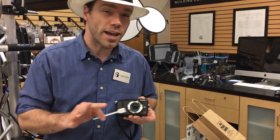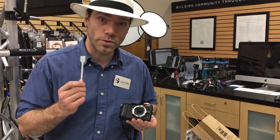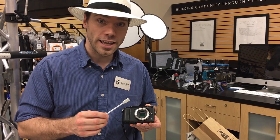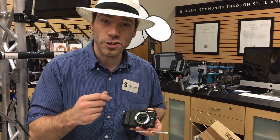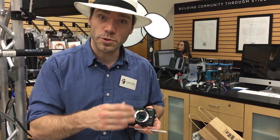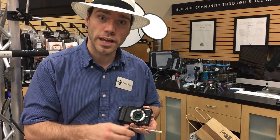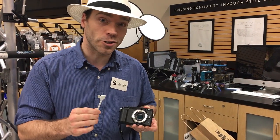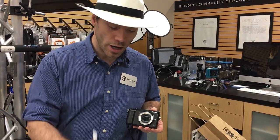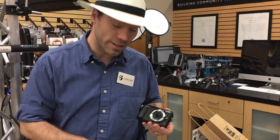I'm going to go ahead and use another swab — that's going to take care of it. The most I've ever had to use is three swabs for stuck-on cleaning. Normally all I need is a brush — a clean small paintbrush — or a lens pen has a brush on it that's good, or just a bulb blower to blow debris off. That's my normal care. This is for extreme circumstances. Don't be scared, get in there, get the right tools — sensor swabs and Eclipse solution — and clean your sensor. Save yourself a lot of money doing it yourself.